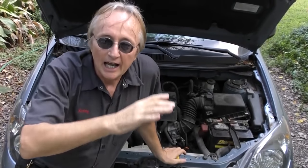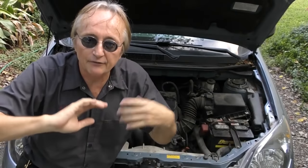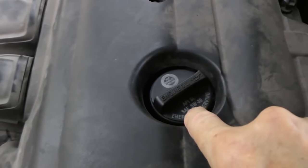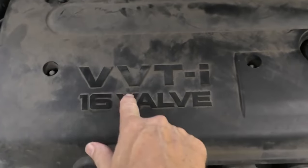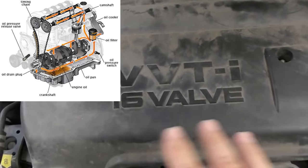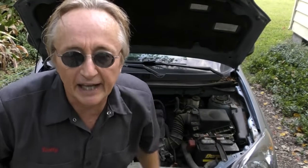Don't put heavier weight oil in an older engine that's burning a little oil thinking it will help. You really don't want to do this in any modern engine. This 12-year-old Matrix calls for 5W-30 oil, and some modern cars even specify 0W-20. Most modern engines have variable valve timing systems that require thin oil flowing fast to work correctly. If you put heavier oil in, it won't flow properly on startup, causing wear in the VVT system. It can also prevent the variable valve system from functioning correctly - the car won't accelerate right and you'll get a check engine light. Stick to what the manufacturer specified.